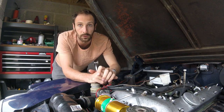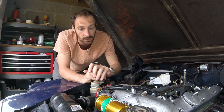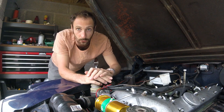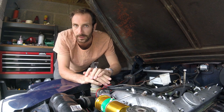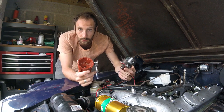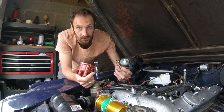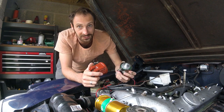When I first started investigating as to why it wouldn't start, there was no spark to begin with. Got a new coil pack - that wasn't it. Luckily this car has got an electronic distributor that replaces the old condensers and points. However, that was installed about 15 years ago, so I had to go buy a new one at 300 pounds. Here's the old electronic distributor - unfortunately it just stopped working. After 15 years, electronics seem to reach the point that they try to die.